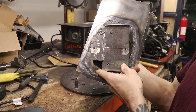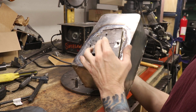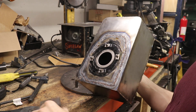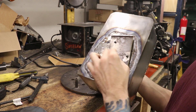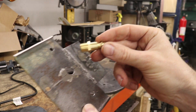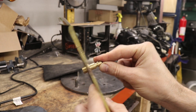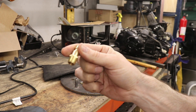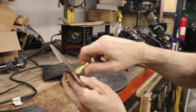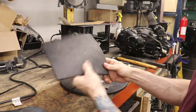Here's our gas tank, and these should fit on here — just like that. I just need a big piece of rubber underneath there in a circle form, and I can sandwich it down and screw it down to put pressure on there. I also need to drill a hole through here as well. I've got my hole in the center designed to fit this little nipple air fitting that goes in like that. This is the female end, this is the male end — stick that through and thread the other side on with a little o-ring in between, and we've got a nice little connection to pump air to the tank.